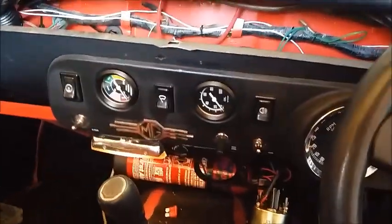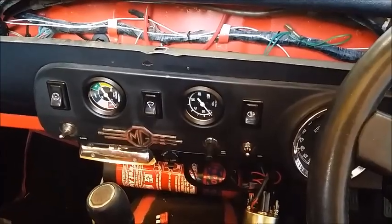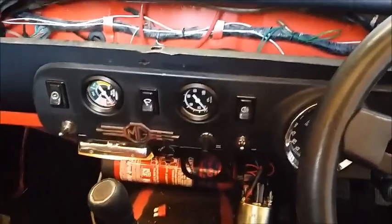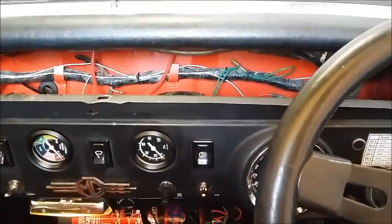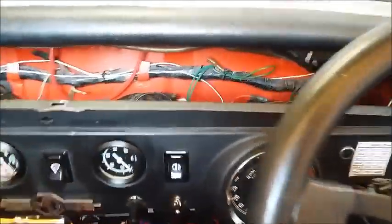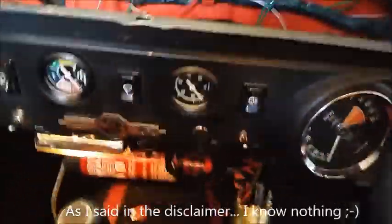Right, so here I am back in the car. Truth told, this is actually take 3. I tried to do this yesterday and came across a bit of a wiring problem that I traced back to a dodgy crimp at the fuse box. And I just tried this now, and it conked out because I hadn't tightened up the earth lead on the battery very well. So I tried to turn the car over and nothing happened. Okay, so take 3, back in the car.